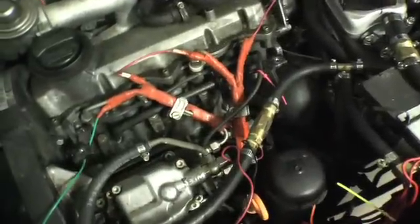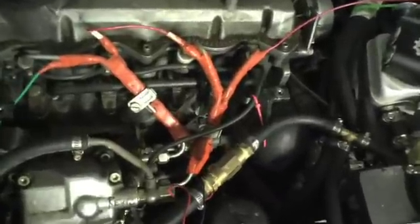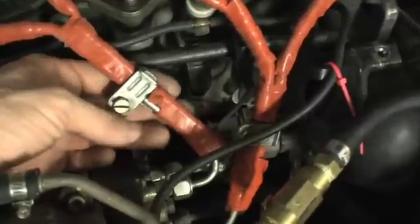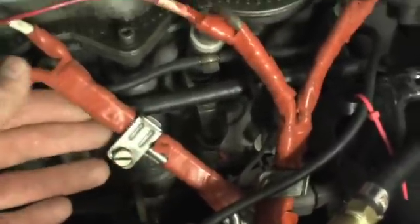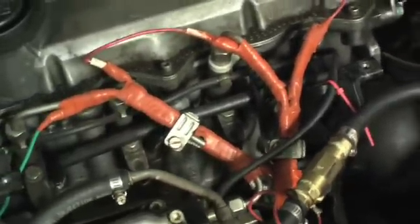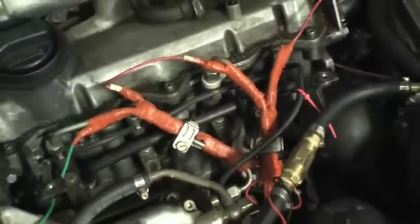There are the fuel injection line heaters. One thing I noticed after installation was that this orange insulation tape, if you wrap it too thin or pull it too tight, it gets too thin and will eventually tear over time. You can repurchase this from McMaster-Carr — it's about $15 a roll for 50 feet, so it's more than enough.